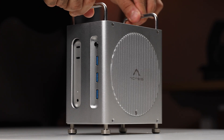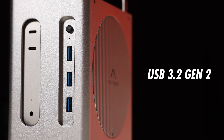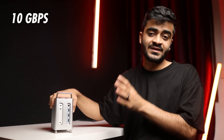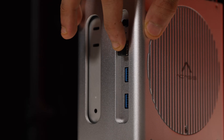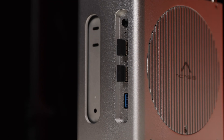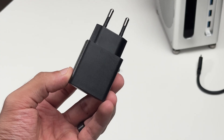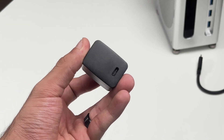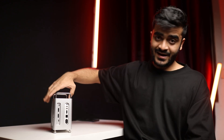Getting to the USB ports on the front — you've got three USB 3.2 Gen 2 Type-A ports. These should give you the full 10 gigabits per second speed if you use external power. If you're just using receivers for your keyboard and mouse, you don't need external power and these should work without it. But if you're going to connect SSDs or external hard drives, there is a 30-watt power brick included in the box with a Type-C to Type-C cable. Once you connect that to the power delivery port on the back, all three USB ports will give you full speeds.